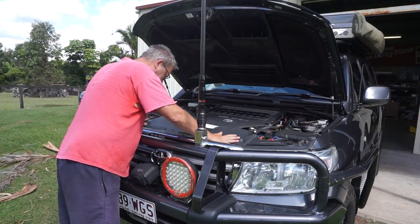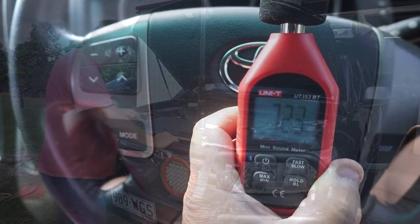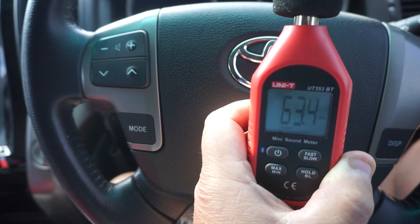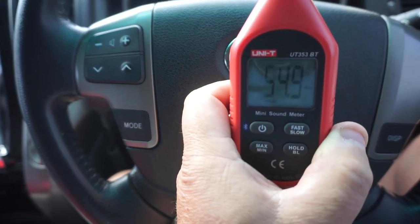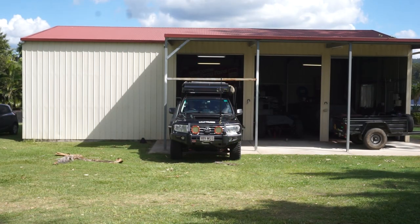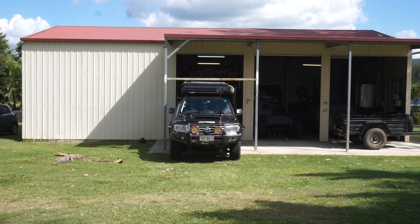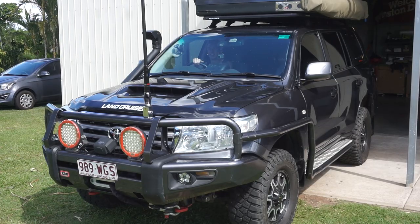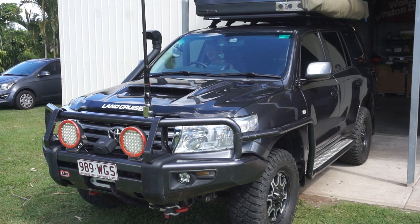The panel is locked down — let's test these horns out. Back in the cab with new horns installed. The in-cab decibel reading is 68.4. At about 15 meters from the car, let's see what note and decibel reading we get. Oh, much better note — 86 decibels at that distance. And at 3 meters, we're getting 96 decibels.